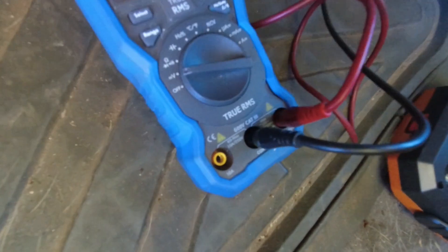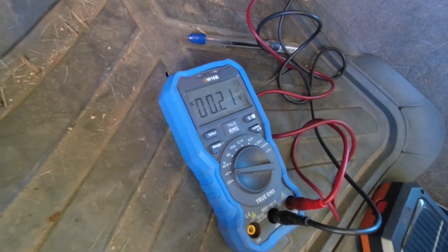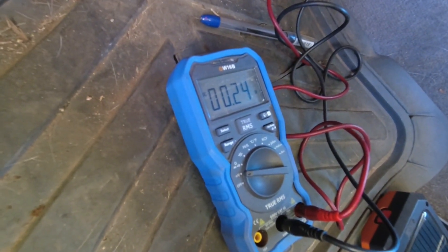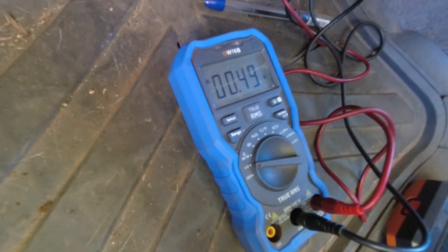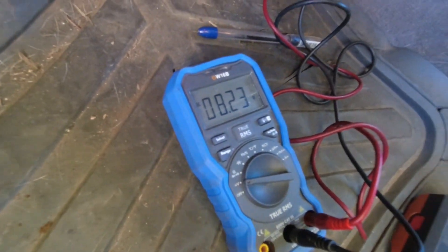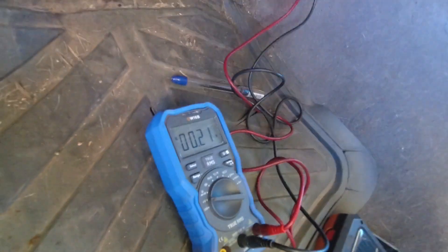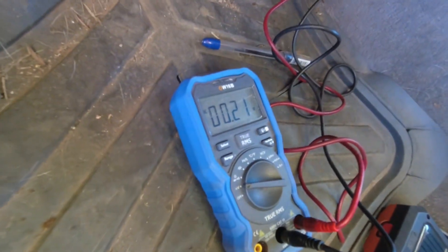That is just so hard to get to and see. In the off position - going to floor/defrost, that's defrost, and then auto - there's eight volts again when I went to panel. It stays on eight for a few seconds but it doesn't change. So I'm thinking that's probably enough voltage to control this motor, which means I'm blaming the motor.